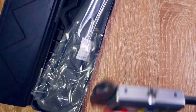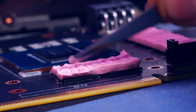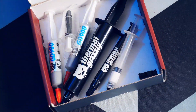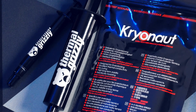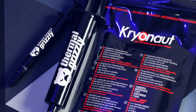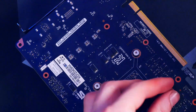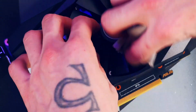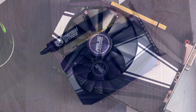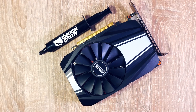So: cleaning from the inside, thermal pad spread a bit wider, and then applying Thermal Grizzly. The paste is expensive compared to other compounds, but in my whole tech career I've rarely not seen a big difference when using it. It's also non-conductive, so you basically can't overdo it. For CPUs I do an X pattern; for GPUs it's good to spread it a little, because you really want the chip covered and there's no chunky CPU cooler to spread it for you.